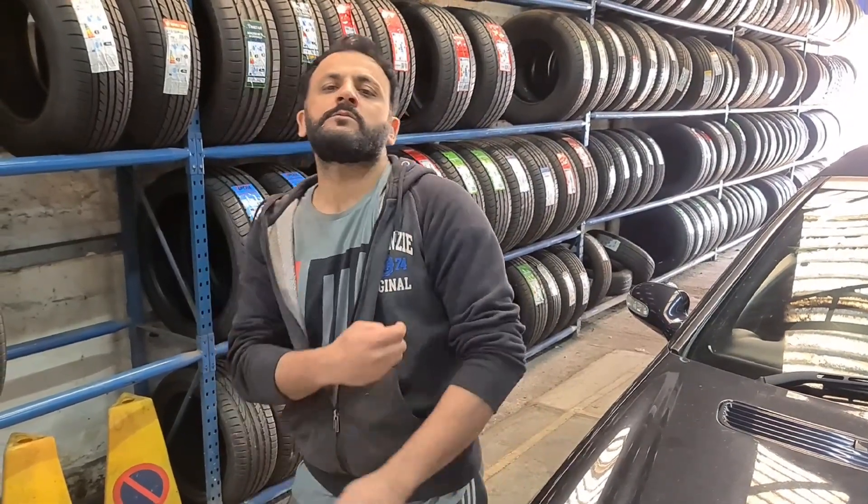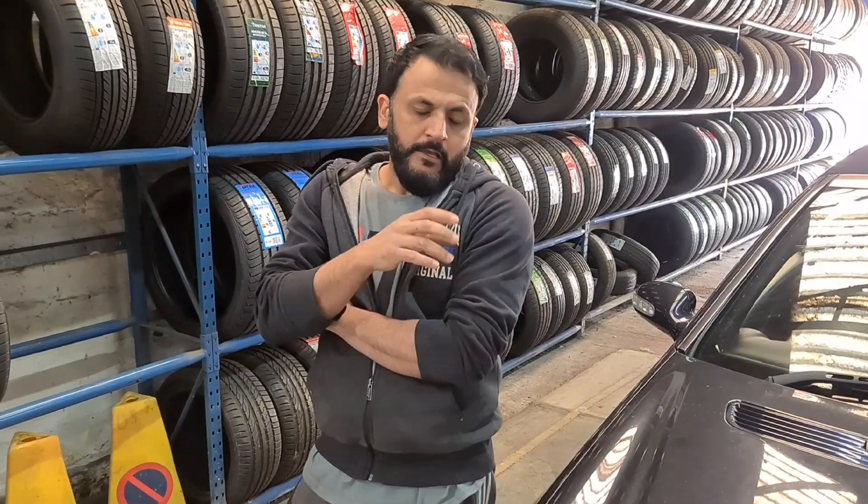Hello from Taj, my name is Medics. I've got a Mercedes CLK here on a 2007 plate, just doing a position lamp. The reason I'm doing a position lamp is because the customer has put aftermarket bulbs on there and it's flickering — it stops sometimes and works sometimes. So what I'm going to do is put the original ones back on there.